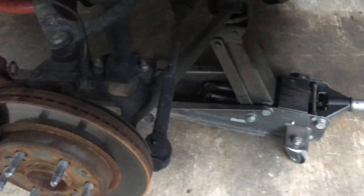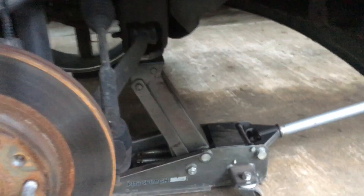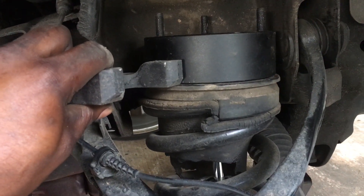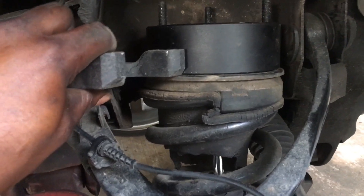So what I'm gonna do is take them out and put the spacers up here. I'm gonna have to take down all this stuff just to get this thing down. I jacked that thing all the way to the top but luckily it was enough. Look at the difference - that's a whole other inch. There's two inch, there's three inch.